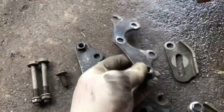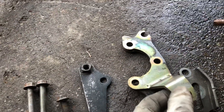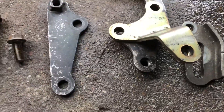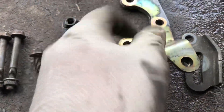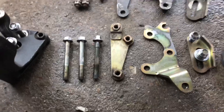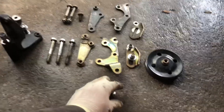The 1MZ bracket looks just as similar to the 3MZ. You can see the mounting points are pretty close, but they're quite different from where they mount to the tensioner part. So I ended up getting these from the junkyard — you guys saw the previous episode. I ended up getting it from a Highlander.